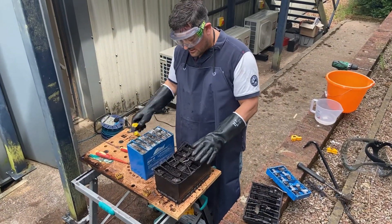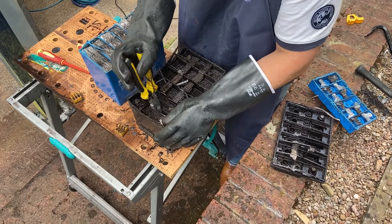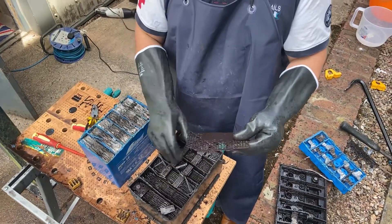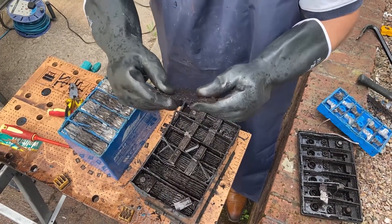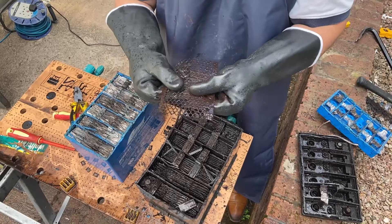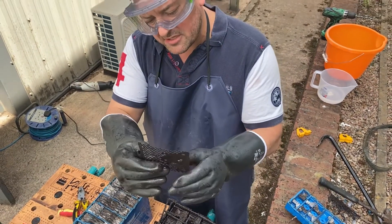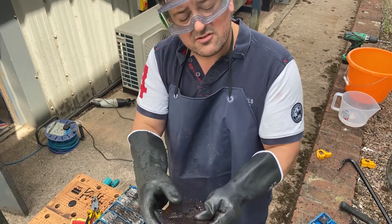Now I'm going to take a look at what the plates within the batteries look like, starting with the standard battery. This is the grid out of the standard battery — we were talking about expanded grids versus cast grids and you can see straight away what's occurred. This is an expanded grid, created from a single sheet of lead that's been stamped and then physically pulled apart to create the grid. You can see it's very weak, very flexible, and it's just come straight out of the battery — you can see this is precisely what we're talking about with shedding of active material. There are holes in it, and the paste has just started to shed inside the battery.